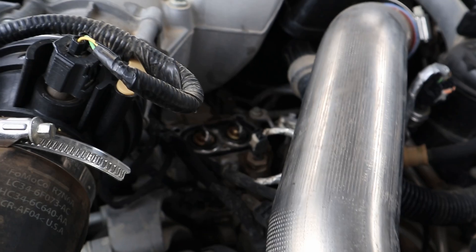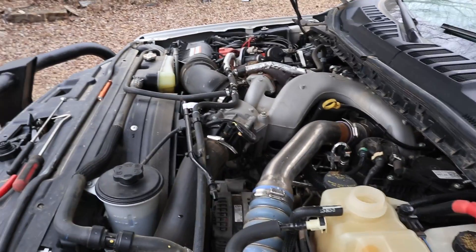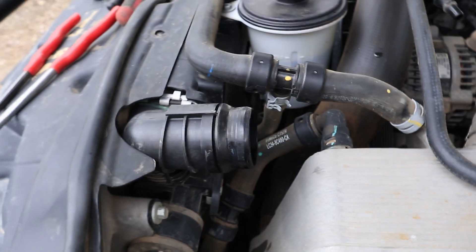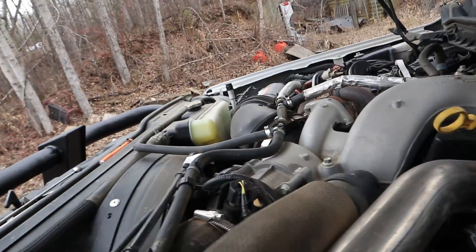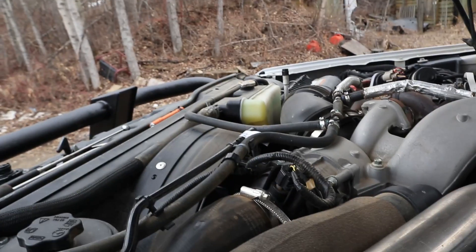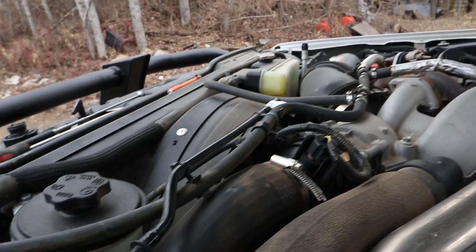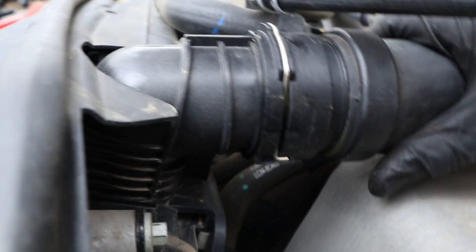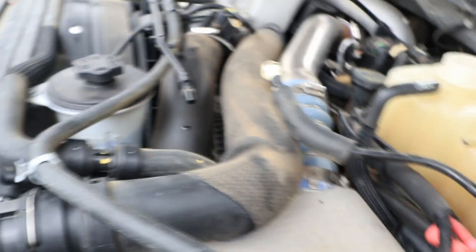Now just put your cover back on — lid with a copper coat on those bolts — and torque them down. Good and tight, but don't over-torque it; you don't want to crack your thermostat housing. After you torque your thermostat housing down, take these clips and reinstall them into this hose. It actually has a little bit of a chamfer so you don't have to put them on after — they'll expand and click on. All I do is a light coat of grease — just anything synthetic, multi-purpose. If you have a silicone lubricant that works really well too. You should be able to hear it click, then give it a good tug test — you want to make sure that's locked on.